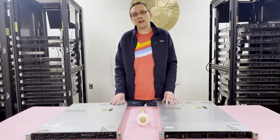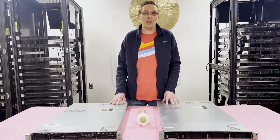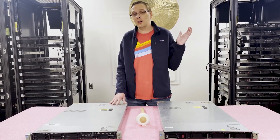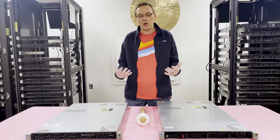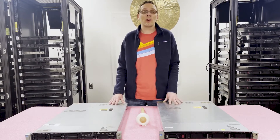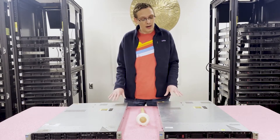The rank rule applies to everything that is DDR3, whether you're using an HP board, a Dell board, a Supermicro board, or any other board — it's always going to be the same. You're always going to run into the rank rule for DDR3 ECC registered.